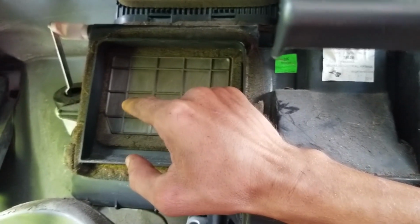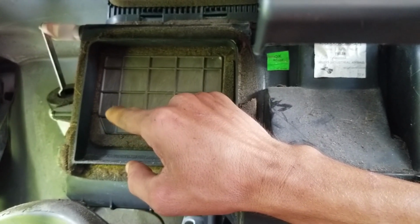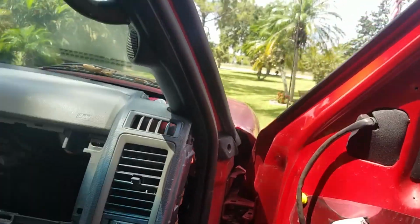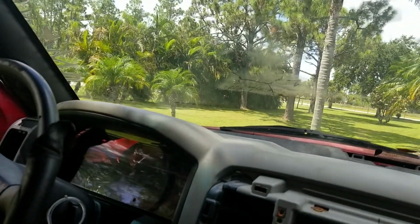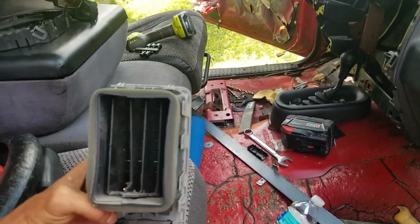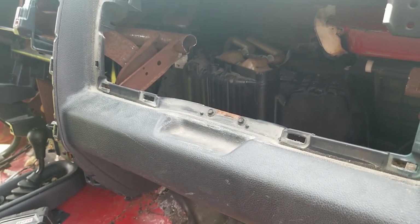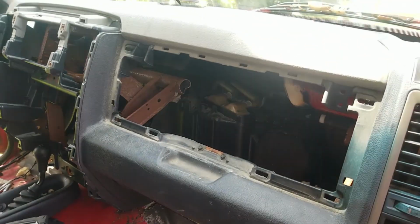From there, I'm going to drill holes and mount probably a thread to thread or a thread to female slip-on for PVC, and then I'm probably going to build the same ABS plastic boxes around my ducts, which if you've never seen one of those, they look like this. Okay, so if you've never seen the back of one of the ducts, they look like that, kind of the same setup. I was planning on building an ABS plastic box around those, putting the hose connection right in the center of it, and then probably running 1 inch or 1.5 inch hot tub hose, like I said. I know I've repeated that, but this has been multiple days, so I kind of forget what I say. But there it is so far.